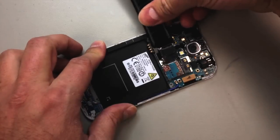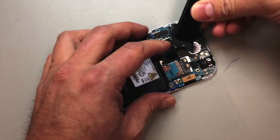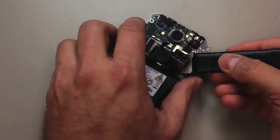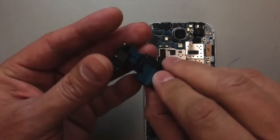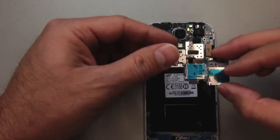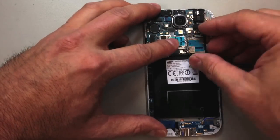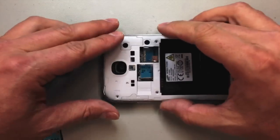Once that's unplugged, take a thin pry tool and very carefully go between the actual tray and the logic board. There are a couple sections with adhesive — the one closest to me right now has the most. Very carefully go underneath, making sure you're not cutting through anything that won't be removed. It will just lift right off the shielding. For the new piece, I recommend connecting the pop connector first so we know it's in the right position, then look at how it fits on top of the logic board and secure it.